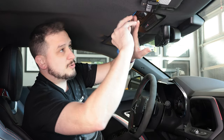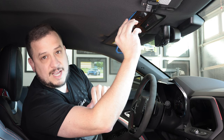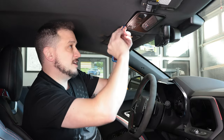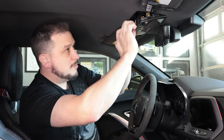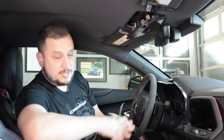I'm going to stay wide for the panel removal and then do a close-up for the harness. Put your panel removal tool in the corners just above or right alongside the LED lights — you'll hear a pop. Move to the other side and do the same, then simply pull it down. The side closest to the windshield just has two plastic pieces that lip in, so there's no need for a panel removal tool back there. There are two harnesses that connect real close, so I'll use my pick tool to get those disconnected.